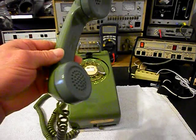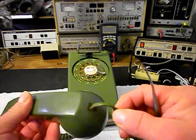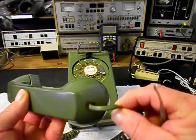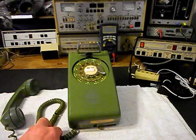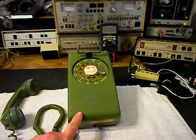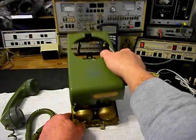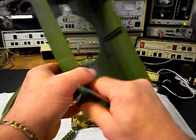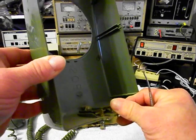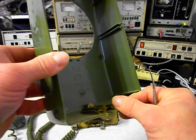I want to take a look at the telephone itself. This is the initial checkout. We know we have an issue right here at the modular port where it goes into the handset. We're also going to check the connection down at the base of the telephone. Now we have the cover loose so we want to go ahead and show you the cover, and we'll show you in a minute how to remove the cover at the bottom. There's actually a little hook here, and this little hook on the cover catches a latch at the base of the telephone.